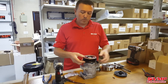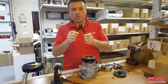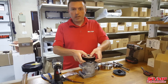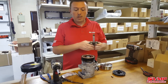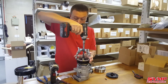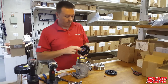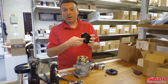The current pulley is held on by a C-clip. You're going to want to use special C-clip pliers to get it off. It has a very, very light press on it, just enough to keep it from wiggling around, but you will need a two or three jaw puller to get it off. As you can see, just a little bit of pull and it slides right off. Now, you always want to make sure you take the C-clip out, or you'll pull the bearing out.